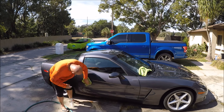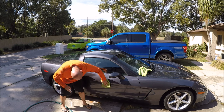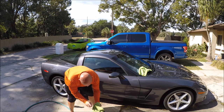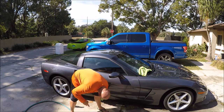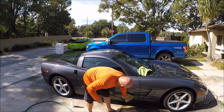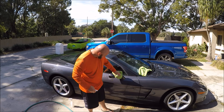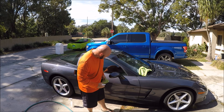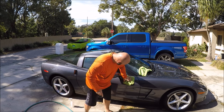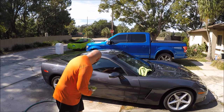I'm going to apply it to all this paint. Take your time and make sure it spreads evenly — that's very important. Make sure there are no high spots. Once you apply it, it cures pretty fast. You can see when you wipe it on, the streaking where the product is laid down will flash really fast. I've done this door and it's good to go — just look around and make sure it's good.